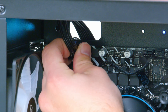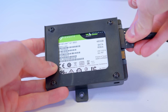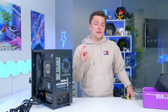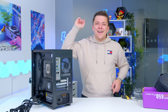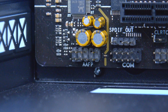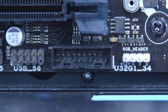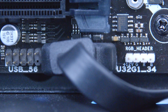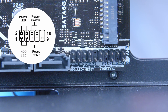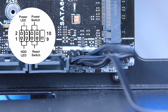We're then able to plug up the CPU power connection to the top left of the motherboard, the motherboard power cable to the far right-hand side, and SATA data and SATA power cables to the SSD, giving them juice and data and then connecting that up to the motherboard. We also need to plug up the USB ports and power buttons on the top of the chassis. We add in an HD audio cable to the bottom left of the motherboard — this deals with the headphone and mic jack on the IO of your chassis. Then USB 3 goes to the right-hand side of the motherboard just past the RAM DIMMs, before rounding things off with the JFP1 connectors powering the power and reset buttons on the top of the case. These are the fiddliest cables of the bunch, but we'll pop a diagram on screen to make it a little bit easier.